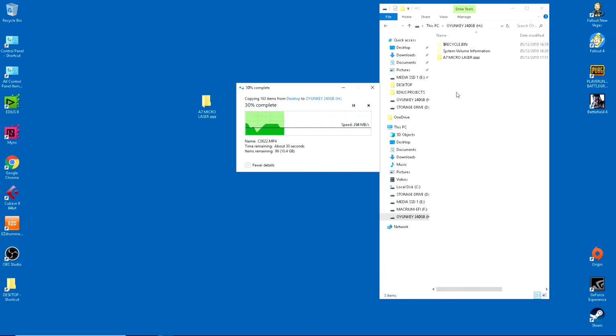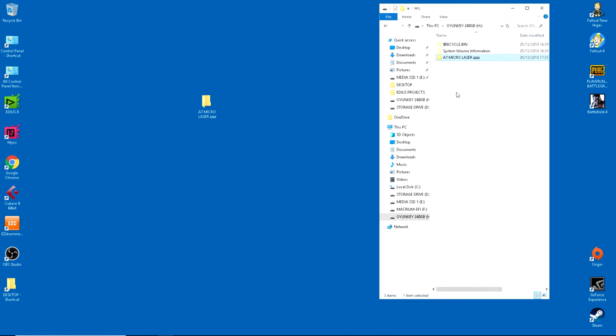Right, okay, so what that's saying to me is that the SanDisk is obviously able to read faster than it's writing, and that's even under the stress of running Windows at the same time. That's a very, very respectable read speed from the SanDisk. And also, we've already established that the Oyunkey in bursts is capable of up to 490 megabytes a second. That's just gone up to 440. I'm going to call that 440 again. So on the basis of that, I'm safely saying that the Oyunkey is definitely capable of average file movements at around 440, 450 on the write speed.